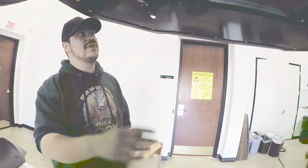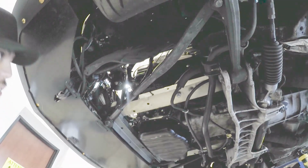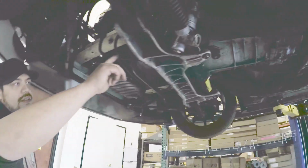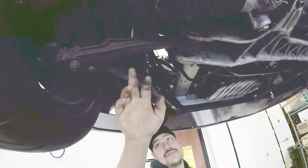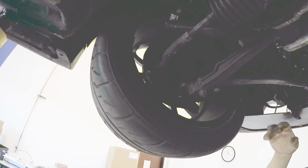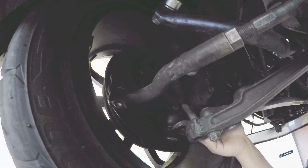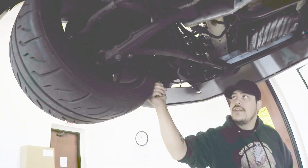You know, because that would actually change the steering angle as you're driving if it were weak. I noticed you got these big box deals right here. The aluminum C-channel is technically a cradle for the motor because it sits farther forward than the aluminum subframe from the LS400. Right. This is lower control arms from the LS400. They've been mated to the ball joints for the TC and then the Camry knuckles. I just basically took the axles and cut the ends off of some crap axles and used them as plugs to keep the bearings together.